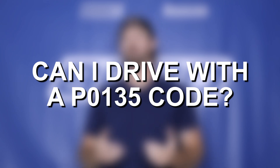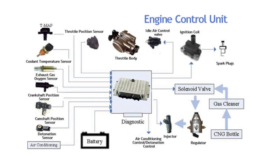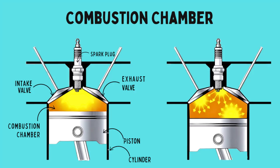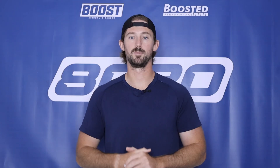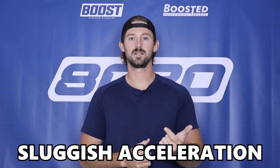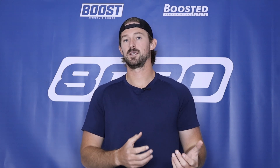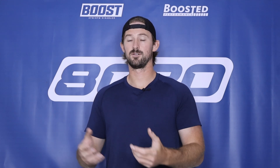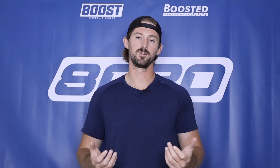It is relatively safe to drive with this engine code, but understand that oxygen sensor readings are relayed back to the engine's computer and are used to calculate how much fuel or air needs to be sent into the combustion chamber. In certain circumstances a bad oxygen sensor can cause rough idle, sluggish or hesitant acceleration, other performance issues, and very poor fuel economy. Because it affects emissions and how your vehicle runs, it's important to replace it quickly, but if symptoms aren't too bad, it's not the worst thing in the world.